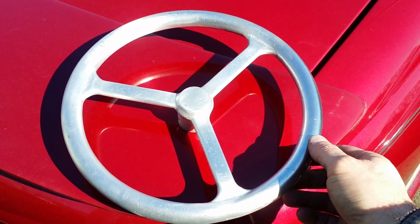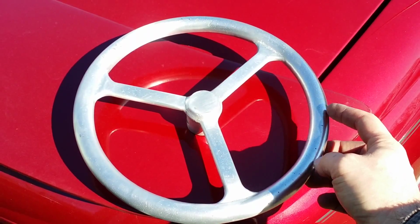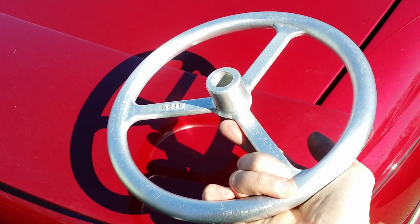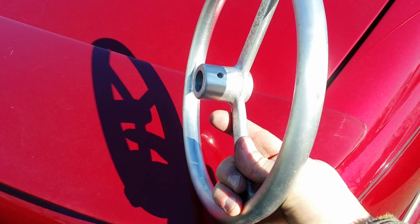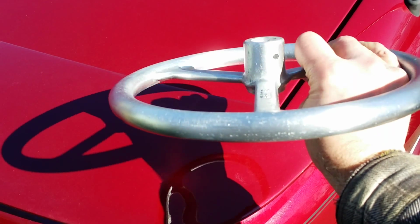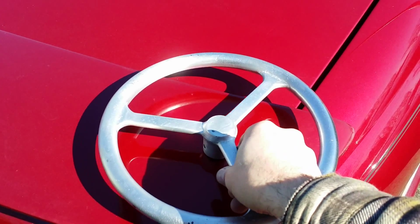I'm going to hit this with some red Scotch-Brite again because there are some sanding scratches that you can really see that are pretty deep, so I'll just knock them down. But then I'm just going to go over the entire wheel with the Mother's lightly. I'm not looking for a super duper polish, but the set screw holes, as you can see, are in. Everything looks pretty good, so I'm pretty happy with it, considering what I started with.